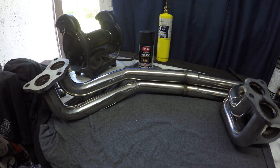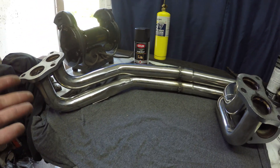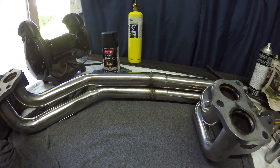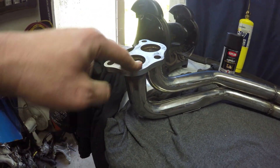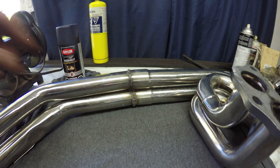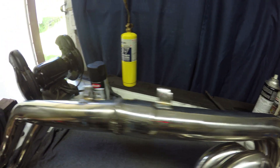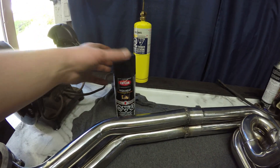I finally have the header all done — it's basically just a one-piece bolt-on unit now, not a bunch of pieces that aren't going to work for me. The flange has been reset on the pipes, the pipes have been welded at the slip joint, and I put an extra little bridge in the center here to kind of reinforce everything. I just want to go ahead and cut those four tangs off the back.